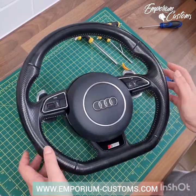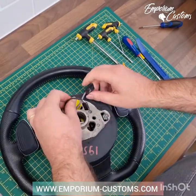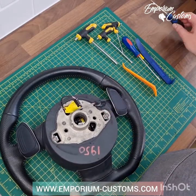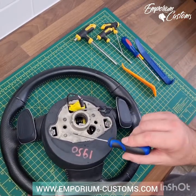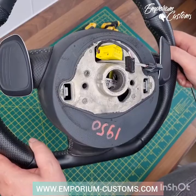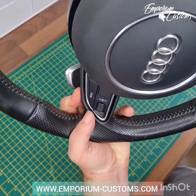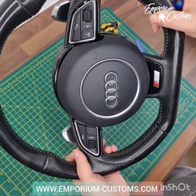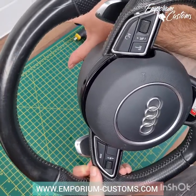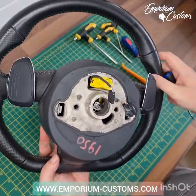What I'm going to show you first is an off-wheel demonstration of taking the airbag off. When the wheel's on the car it's actually quite difficult to get these off, so hopefully this will give you a more unobstructed view. Because when it's on the car you can't see any of this at all — you've got to turn the wheel round on its side. I use my phone on selfie mode, put it on the dash so I can see the back of it.